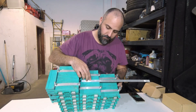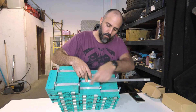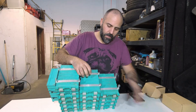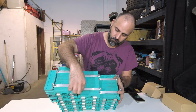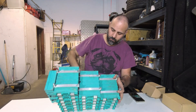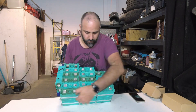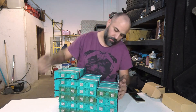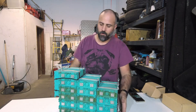As you see, if I let it go, it won't move. I cut it the length of the battery, and then using the threaded rods and the plastic shrink wrap protection, the rods go all the way down to the battery. As you can see, they pull up on it, and these rods will not let the cells move from their place.